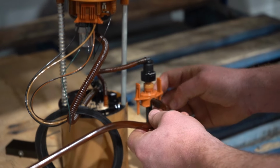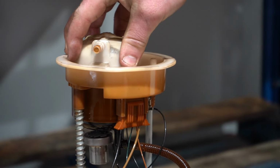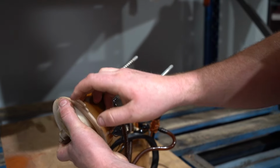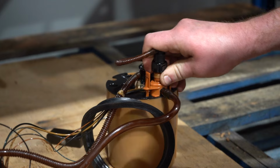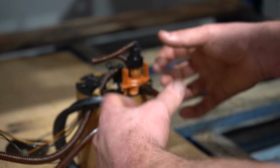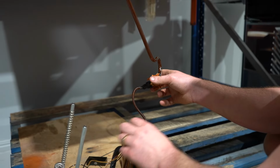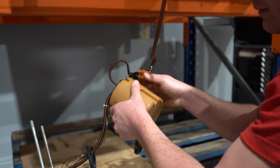Okay, so to get it out of the tank, the top, we should be able to redo this. It comes off like that, and I tipped it to the side, therefore gaining access to this area, and this little orange part was in this pump like that, and you can see it floating there at the bottom. And to pull it through the hole, you have to remove it by pressing those tabs, and I pulled that breather pipe up, and therefore the rest was just able to pop through the hole, and then you just rotate it out of the tank like that.